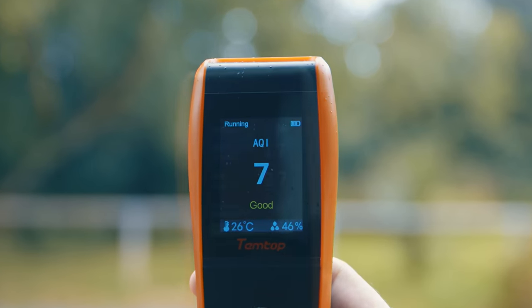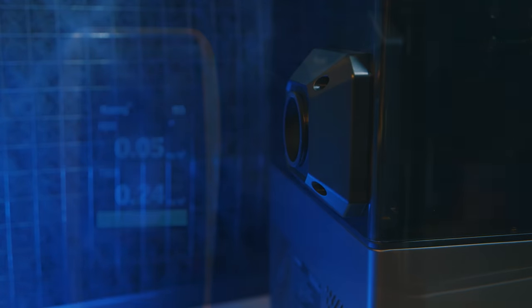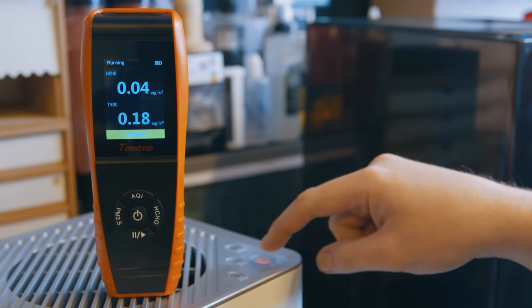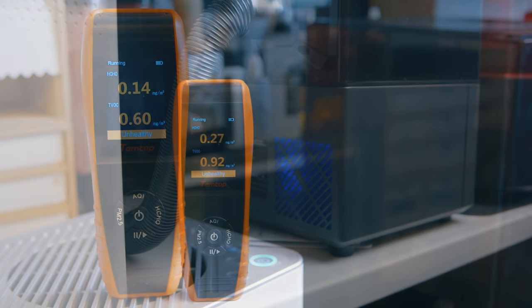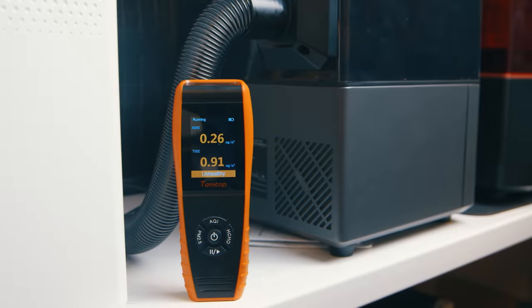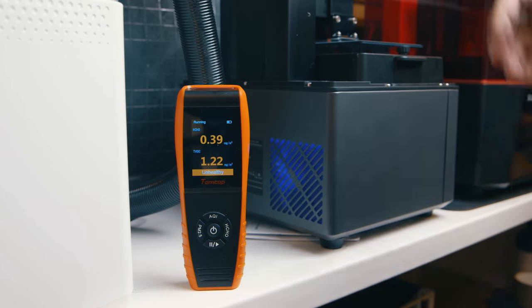So after doing this, I started getting measurements, including outside. I live in a fairly rural area on the edge of a town and have pretty decent air quality. I took my first measurements of the printer directly out the back of the unit after removing the vent hose. VOCs reached a value of 0.53, which is very marginally into the moderate status of pollutants. Before doing another test, I left it to rest for a few hours so that any VOCs in the air from the first test could settle. On my next print, I placed the detector on top of the Mate and turned it on. At this point, the detector rapidly shot up to 0.6, which is still at the low end of moderate. I left the Mate on for a while with the detector next to my printer in between the two devices, and it got as high as 0.92 — almost halfway to the unhealthy category. When the Mate was turned off, the sensor slowly dropped down and settled around 0.9. But when I took the lid off the printer, the detector went all the way up to 1.2. So it's definitely picking up more nasties in the air when it's directly next to a working printer.